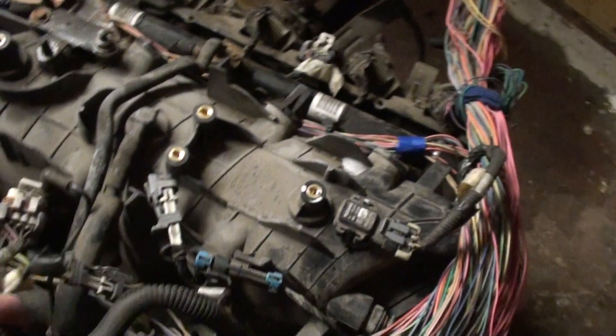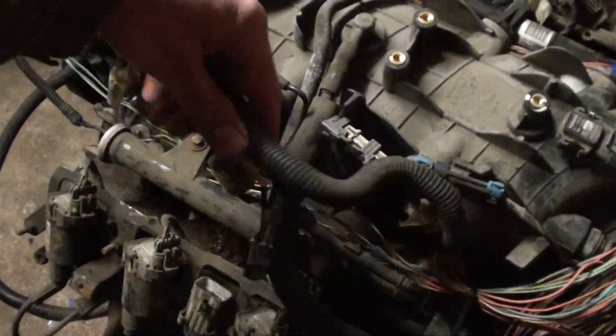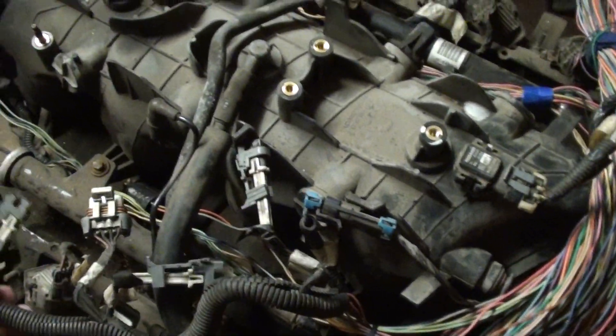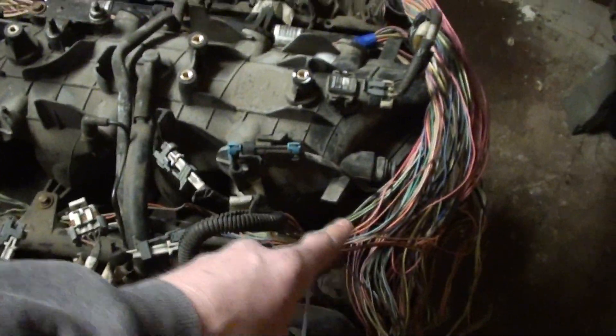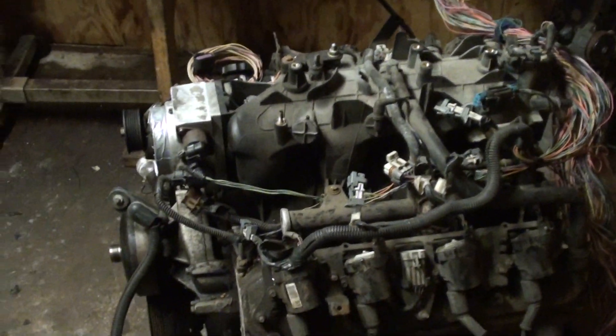I use a Dorman fuse block. One thing I need to do is the driver side injectors and coil pack — this is how I want it wired. The only issue is this connector covers number one, three, five, and seven, so I'm going to have to move the pins around in the back of the connector at the ECM. It's easier to rearrange a few wires there instead of chopping and lengthening the wires here. I want the wires coming back here, with the bulk of the harness tucked under the intake and the PCM over where the HVAC block was.